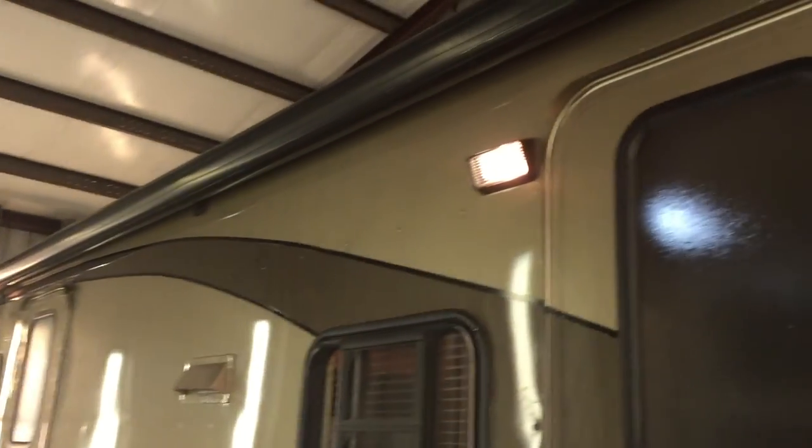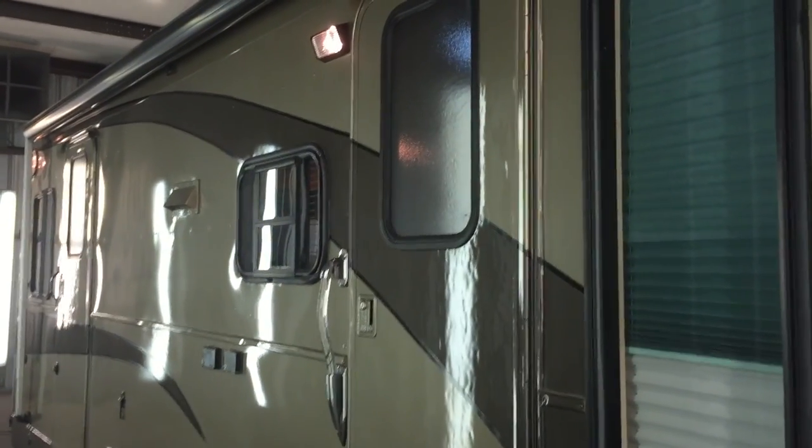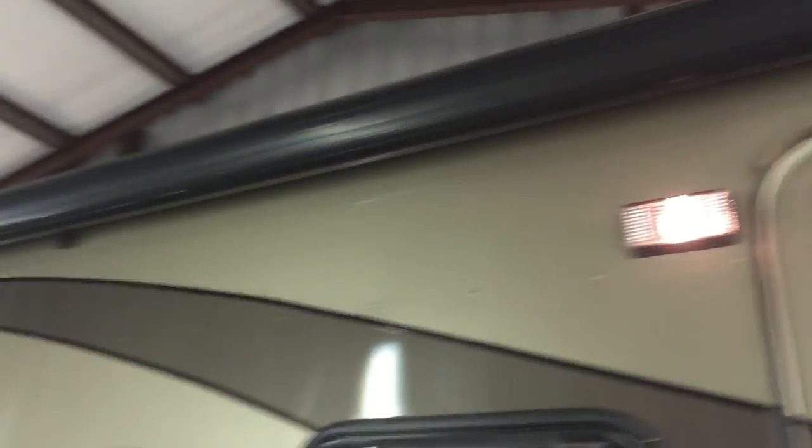If you know anything about the old Holiday Rambler Aluminolite series trailers, they were built like tanks. Holiday Rambler had their legendary alumiframe construction — they used aluminum framing that was interlocked and it was near bomb proof. Once they interlocked them together, they were spot welded. And then instead of a laminated skin, this was an aluminum skin that was pop riveted to the frame. So there's no such thing as delamination with an Aluminolite trailer because it's not laminated to begin with. It was a completely different manufacturing process and it was a hundred times better than anything else on the market then, and really in the market now. This construction method is really just expensive to do and that's probably why we don't see it anymore.